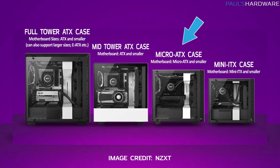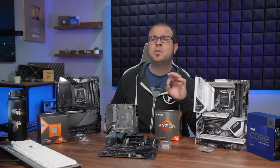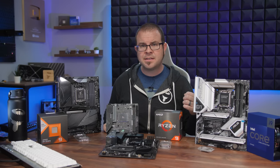Next is the form factor — also known as the size of the motherboard. The typical size is ATX; that's the most common, and it's where you'll find the most options available, giving your system the most flexibility and room to grow. If you get an ATX-sized motherboard, also get a case that supports ATX motherboards. There's also mini-ITX — tiny boards meant for compact small form factor builds. These are very cute but can be a challenge for new builders due to odd layouts and tight spaces for cable management. There's also the middle child micro-ATX, which is in between ATX and mini-ITX, but you won't find as many cases or motherboard options in that size.